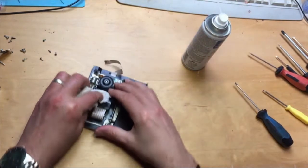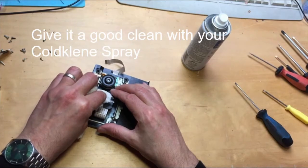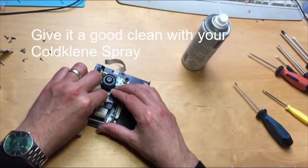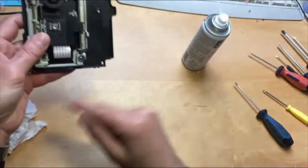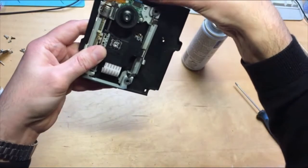And get onto the laser eye and give it a good clean. Get your fingernail in, but don't scratch it, but get onto there and give it a good old rubbing, okay? And clean that. Very often this can solve your problem if it's not reading the discs, okay? And that'll save you having to buy a laser as well. So give it a good clean, make sure this is rotating okay, make sure this cable is inserted okay.